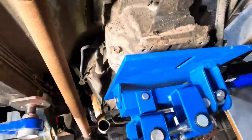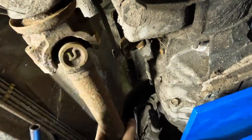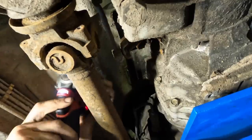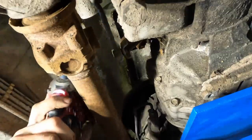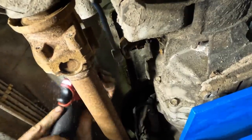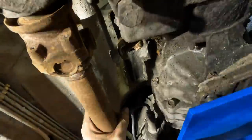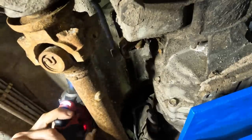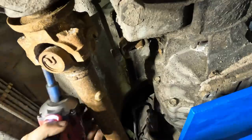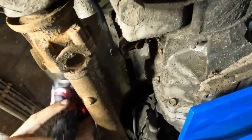Man, this is going easily. I actually forgot to pull the driveshaft out of the front. Well, I was just preoccupied. Same as the rear driveshaft — nothing special. Take the bolts out, take the straps out, take the shaft out, set it aside. This one's covered in less dirt, that should be easier. The dirt's just caked on everything. They definitely had this thing out four-wheeling at one point. That's probably what happened to the rear differential — they one-wheel-wondered it to death.